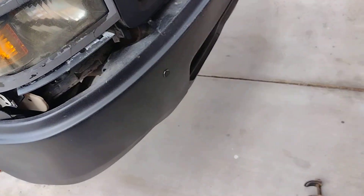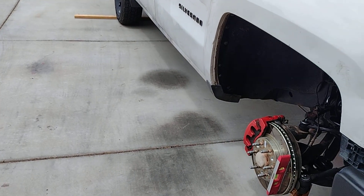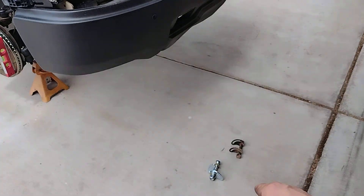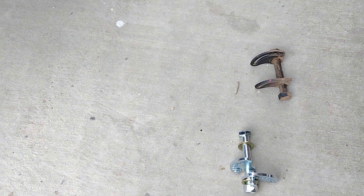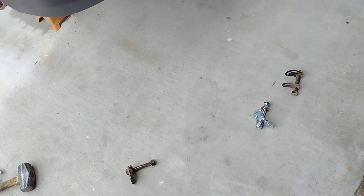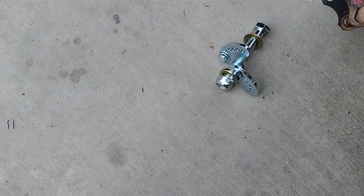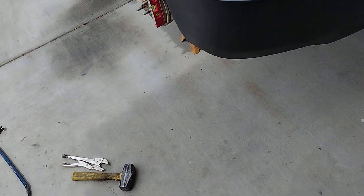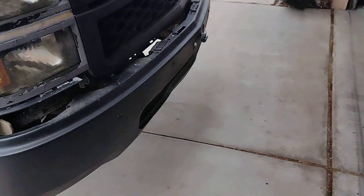This is a quick video of what I did and how I corrected this. I saw another video on installing these — in that video he used bolts because one of his pins was missing, but as you can see I can't use bolts. I can't speak for the longevity of this product. The documentation says to go get the truck aligned, and basically you make marks like I did — you can see I've got the red mark here on the factory cams — and you're going to line those up. Since I'm going in for an alignment, that's not an issue for me.